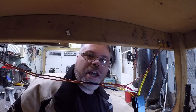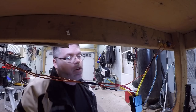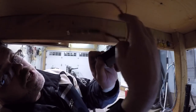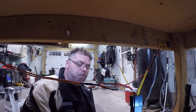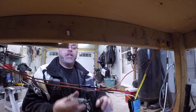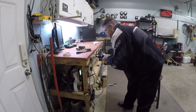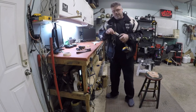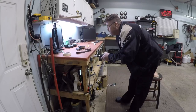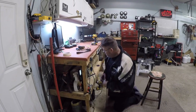Let's try this thing out. Let's plug the relay in. So basically the power line goes into the relay, the ground line goes to the ground on the relay, and ground to the equipment. So what happens is when I touch this to the positive it turns it on — listen, see that? So that's how it works. I just gotta put a two-way light switch in between there and there, and then that just activates the relay. The other switch I was using just doesn't work for it — I tried every which way but loose and it doesn't work.